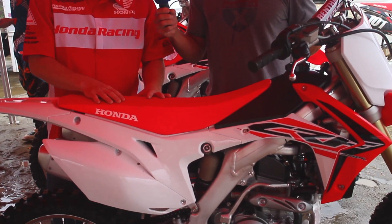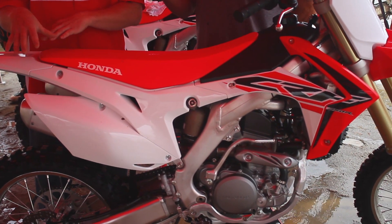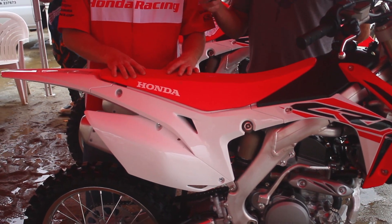To get the exhaust out of the thing, we've added a resonator pipe to the header, which you can see just down there behind the header pipe, and also opened up the mufflers a little bit for more free-flowing exhaust. All those changes again focus on getting a little more top-end power while maintaining our good low-end, bottom-end, and mid-range power.